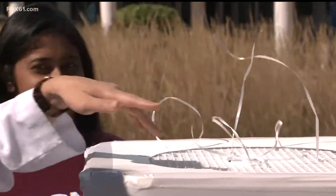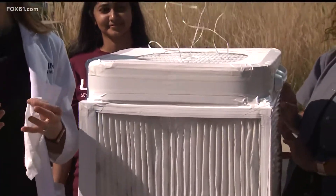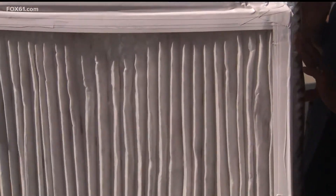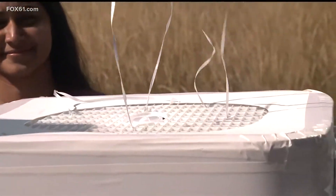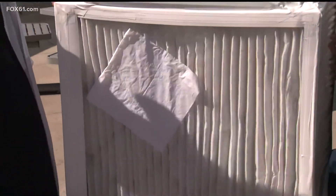All right, so Marina, just talk a little bit about what this does. So this do-it-yourself air cleaner has a clean air delivery rate of 600 cubic feet per minute, which is just about as good as any top commercial HEPA filter on the market. It is able to suck dirty air from an indoor space in through the sides of the Merv-13 very tightly woven filters, and out the top comes the clean discharged air. Any small particulate matter that is in the air that we would otherwise breathe into our lungs gets trapped in the filter. You put a tissue to the side and you can see it sucked to the side.